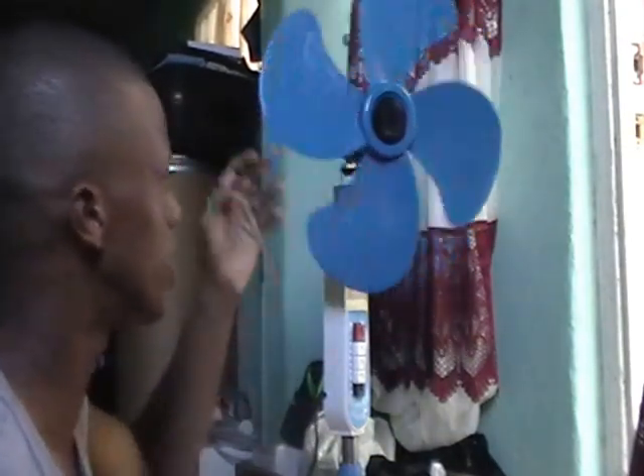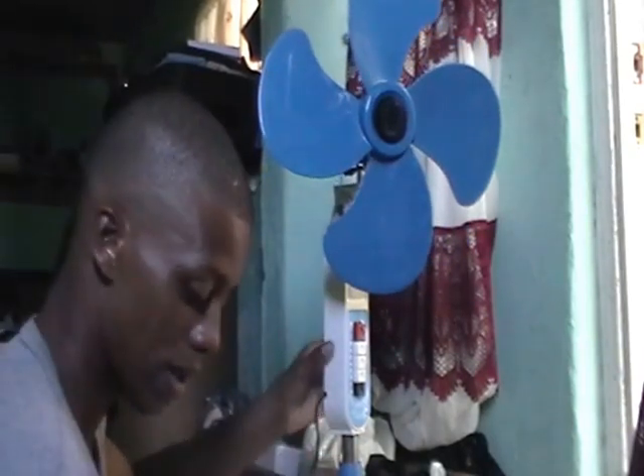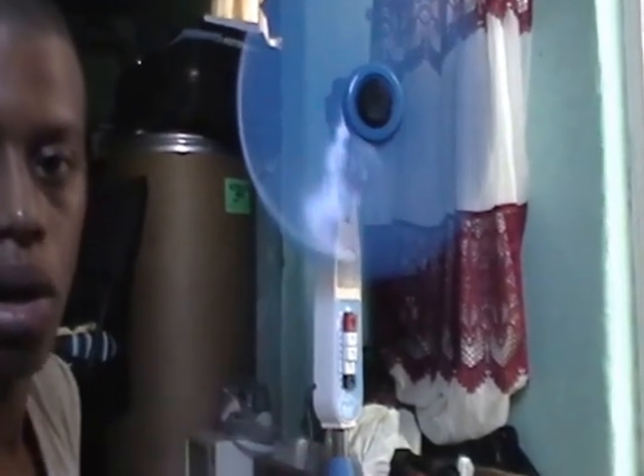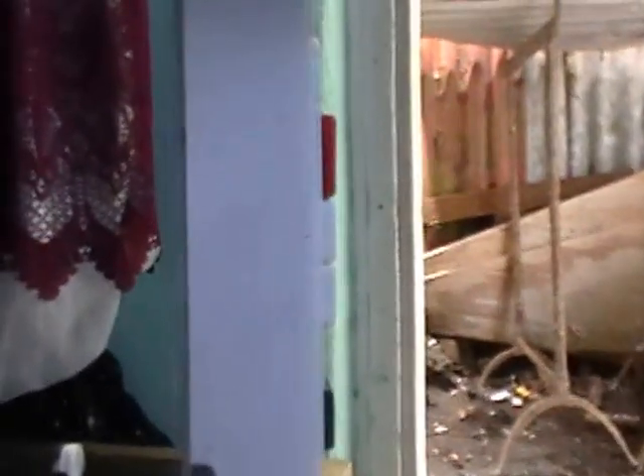I think that could be one of the reasons why this fan is wobbling. I'm gonna plug it in now and show you. It's in — you see it start and it's turning. If you look closely at the side view, you can see it's sort of wobbling a little bit right here — all of that fluttering, vibration, and shaking. I think the capacitor could actually be the cause of that.